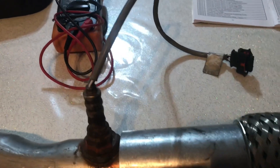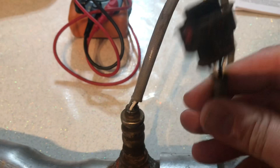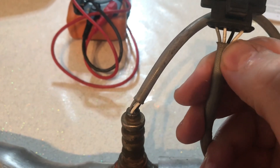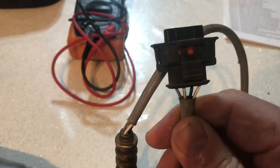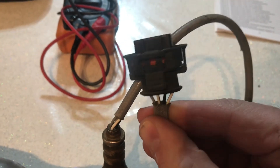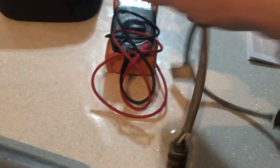This is the exhaust from our Vauxhall Opel Vectra — this is the downstream O2 sensor. If you get a code like I've shown you, you've got a four-pin connector with four wires. The two white wires are your heater sensor wires. When you start the car, the O2 sensor has to be at temperature to get a good reading, so if those don't work, your car's going to be running pretty rough.